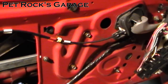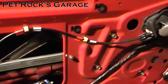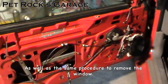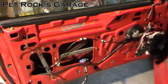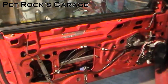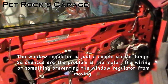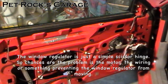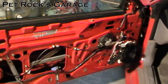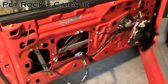Today I'm going to remove the window regulator and swap out the electric motor for one I picked up at a junkyard. This is exactly the same procedure — minus swapping the motor out — that you would use if you were replacing the window regulator itself. There are companies that make the window motor separate from the regulator, so check around and you should be able to find just the motor, which will probably save you 30 to 40 bucks. I went the even cheaper route and pulled a motor from a window regulator at the local junkyard. The first step is obviously to take off the door panel.